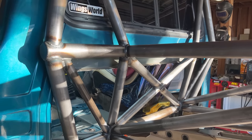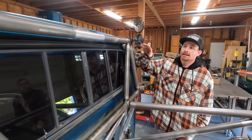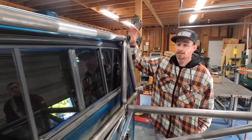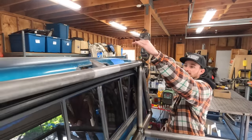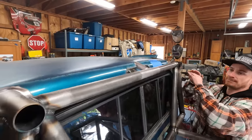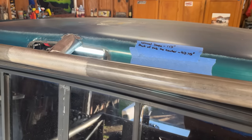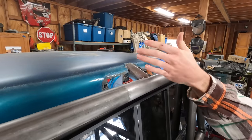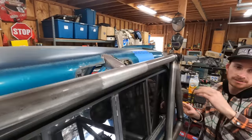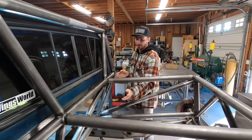Once you had those main tubes in, it was just connecting all the dots with stringer tubes. You can see here — this tube is poked out right here. It's not low because these outside tubes are tucked as tight as possible inside the cab. Because this roof is crowned both ways, the very center of the cab is the highest point. So when it's tucked tight like it is, it's going to come up away from the roof tube — you've got to dive it back down. The factory third brake light hole got cut bigger for the tube, and there'll be another stringer tube here and here. Once those are in and everything's welded, I can make a patch panel and silicon bronze it all back in. All the straight tubes that run across the truck were put in first, then all the lacing after.